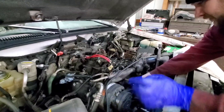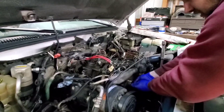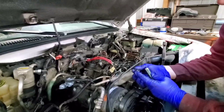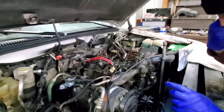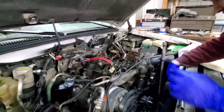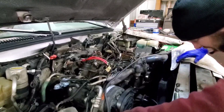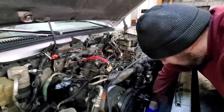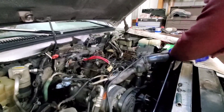I'm detaching the impact from here because I want to feel by hand to make sure that it's out. I grip the underside of the washer with my index finger as I'm pulling it out - that way I know I've got a hold of it and it doesn't drop down into the motor. We don't want to have to pull the front timing cover and all that fun stuff to chase it down. Try not to smack the crap out of the radiator like I just did - that's bad.